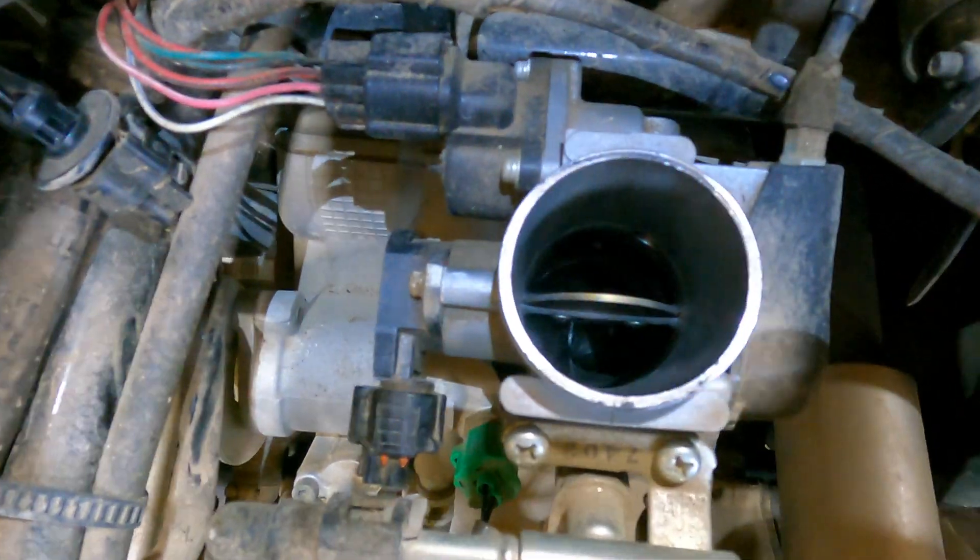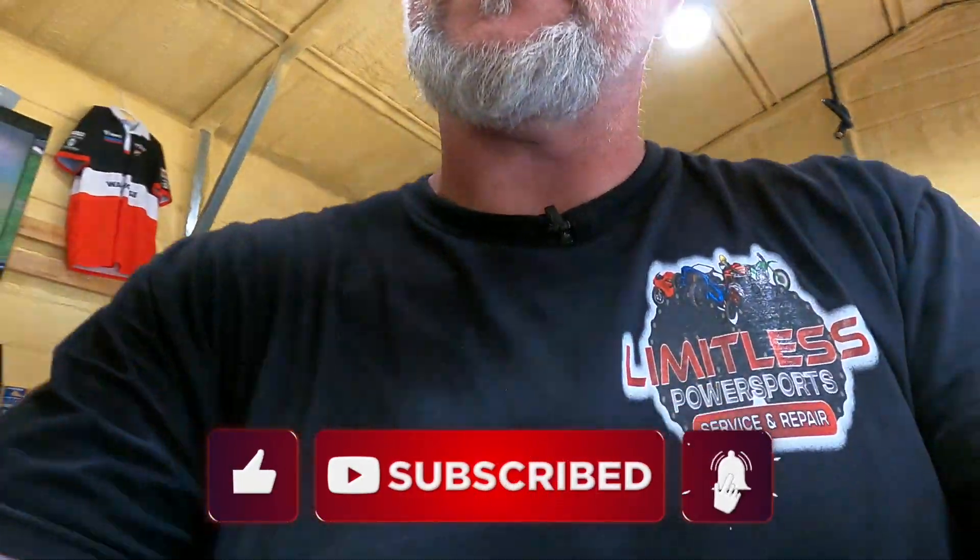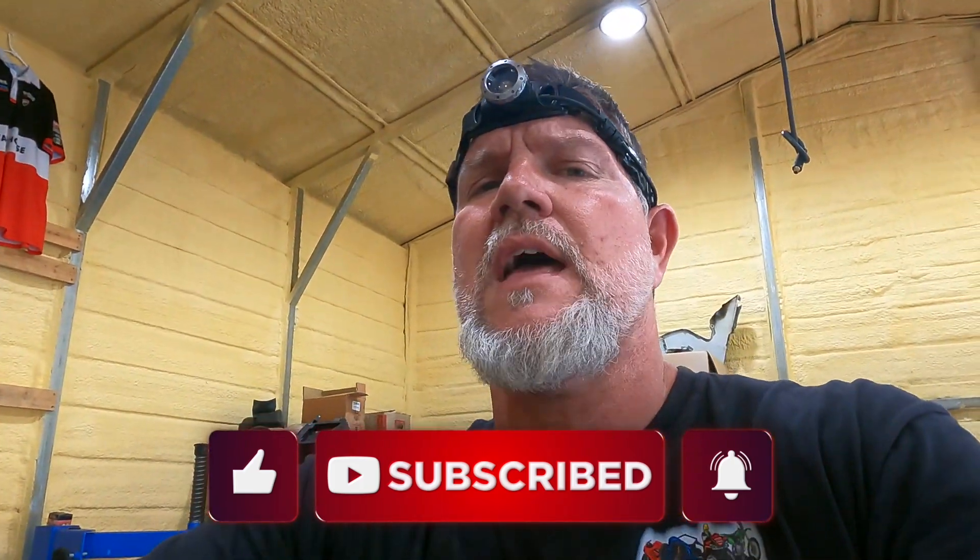Now we can see it shooting. So we know the injector is working. Let's go ahead and take the spark plug out. Actually, I'm going to make sure we're getting power up to the coil first, and then we'll pull the spark plug out and take a look at that. Now he has had mice in here. I'm looking at the wiring because I want to make sure there's no broken wires anywhere down below. I will look over this harness intently trying to figure out why it's not firing up. We do have a little bit of issues there, so we're gonna get a new air cleaner for him. He said he had spark and had tried shooting starter fluid down the cylinder. We're gonna check it all out and see if we can figure it out.